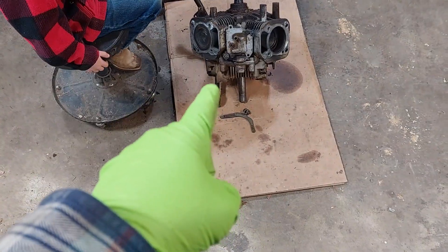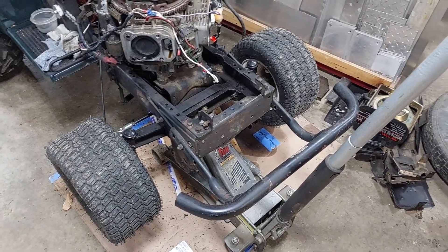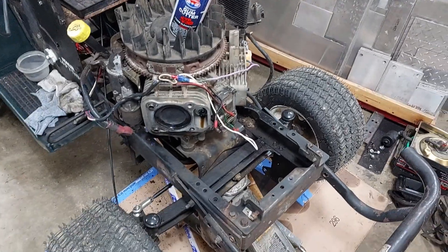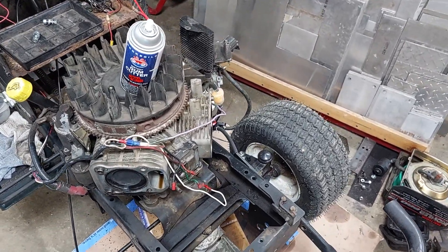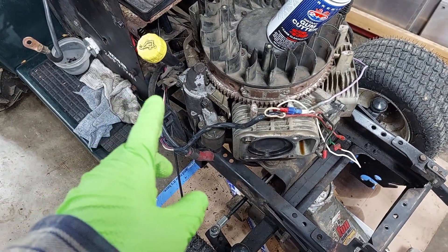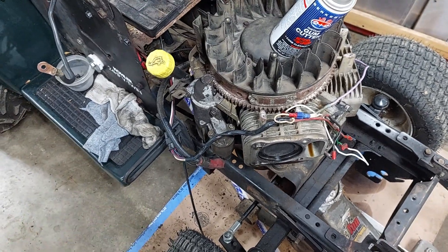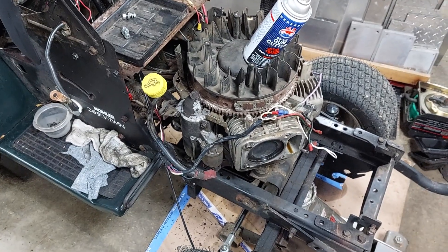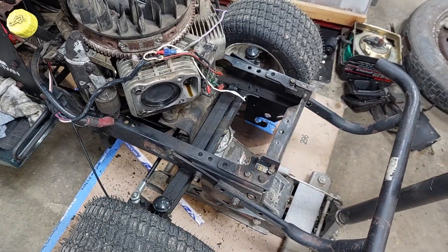The helper hopefully won't be a super distraction. The engine that came off is probably good but it's just going to scrap. I did save the heads off of it because they were good and heads can be tough to find and new ones are kind of pricey. This is the 24 or 26 horse - most everything is interchangeable between these engines. I'm using the starter off the 24 horse because it's the same starter, and the 26 horse starter was acting up - when I went to take the battery cable off the primary terminal on the starter it just ripped the solenoid into pieces, which probably explains the issues.